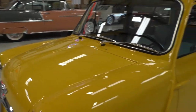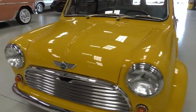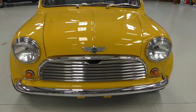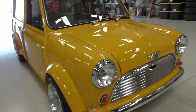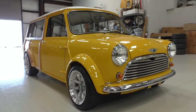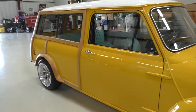Fit and finish overall is very professional. I don't know what color you'd call this — it's a bright yellow but with a cool feel to it. Under the hood is a one-liter four-cylinder original-style engine with a single SU carburetor. It has a four-speed transaxle up front, so it's front-wheel drive, with upgraded disc brakes up front. I drove it down the road — absolutely a blast. The factory rated these at 70 miles an hour and I feel it could do that pretty easily, but it's more of a get-around-town, have-fun kind of car.